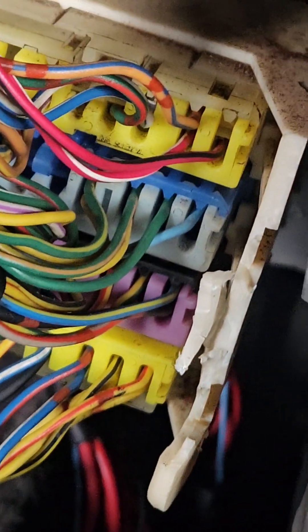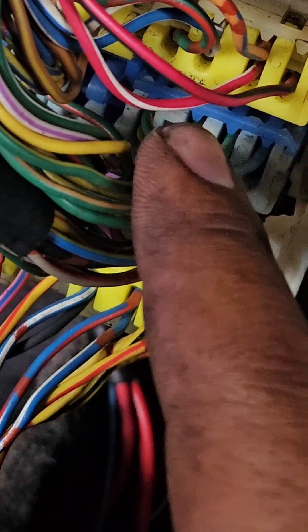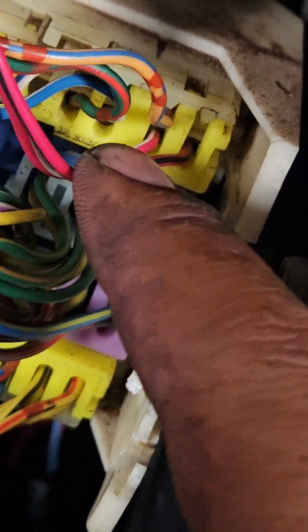The last thing is the speedometer. I'm assuming it's actually these two wires right here. I have the speed sensor unplugged — the red-white wire gives me five volts and this one gives me some random weird reading, so I'm assuming this is the speedometer wire. According to the diagram, the speedometer has three wires: one is power, one is chassis ground — which should be up here, I think it's yellow-blue — and that chassis ground goes directly to the speed sensor.